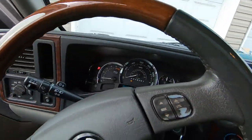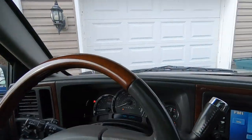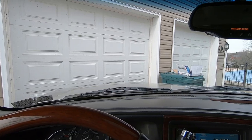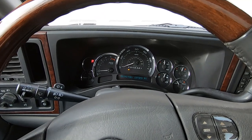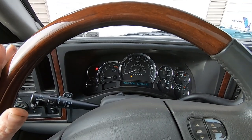It's got a 4L65E transmission, which I don't like. The 4L60 I don't like at all — the 4L65 is slightly better because it's a little heavier duty, but it's essentially the same transmission. I'd much rather have the 4L80E. Right inside there we have the Yukon XL Quadrasteer — it's a 2500 and it has the 4L80E, a much better and stronger transmission. I like the way it shifts way better. If you have a half-ton Chevy, GMC, or Cadillac in this generation you could definitely benefit from having this upgrade.